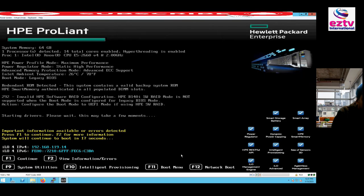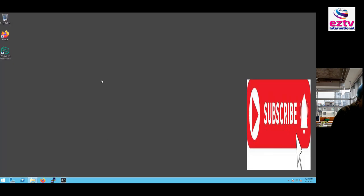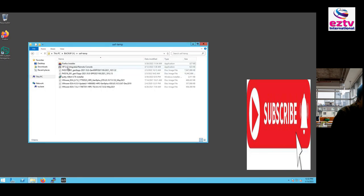I have F11. All right, I have a tool here called the iLO Integrated Remote Console, and I also downloaded the Gen 9 service pack from the HP portal. I also have the Gen 10 one, because if you want it for Gen 10, you need this service pack ISO file. And I also downloaded the HP iLO Integrated Remote Console.